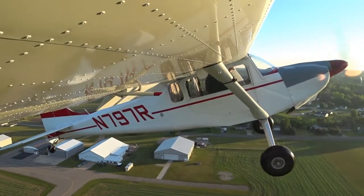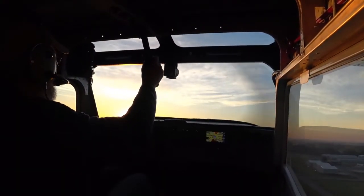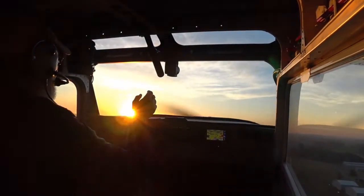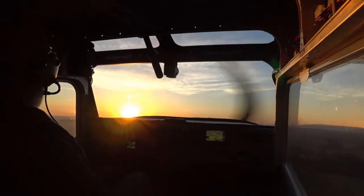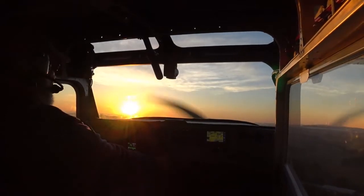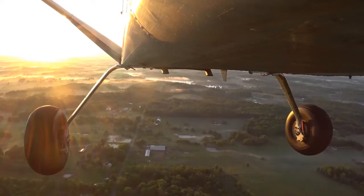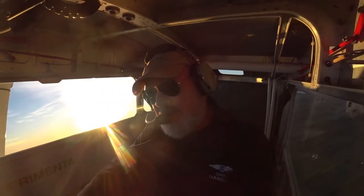For this Prince prop, when you get it up, push it over — for cruise is why that prop flexes, and the next thing you know you're over-revved, so you've got to be kind of careful. Temperatures and pressures right now looking fantastic. What a gorgeous morning. I'm going to attempt the dreaded stall here, doing a clearing turn to get away from the city.